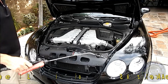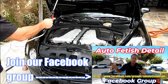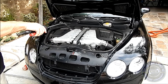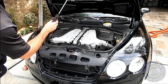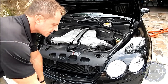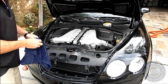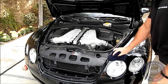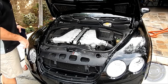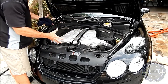Because this is a relatively big engine, I'm going to use my pressurized sprayer. As I mention in other videos, we've got to remember the top of the hood — we get so fixated on looking down here that sometimes we forget to look above us and see the dirt up there. The degreaser I use is not caustic; it will not damage materials, but I do keep a microfiber handy so that if I get some overspray in the car I can just wipe it. I always apply caution, and make sure you do the engine first because you will get some overspray and sling and make a mess around the perimeter of the car, so you want to get this dirty work done first.